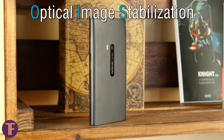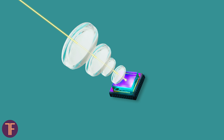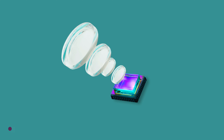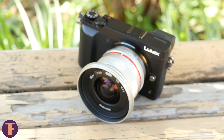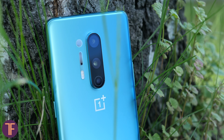My name is Bogdan, welcome to TechFellas! The oldest one is optical stabilization. It works by changing the optical path of the light beam from the front lens to the sensor. It can be done by the movement of both the lens and/or a sensor. For example, our budget camera Lumix GX80 uses sensor shift stabilization. On the contrary, in smartphones it is not so popular.